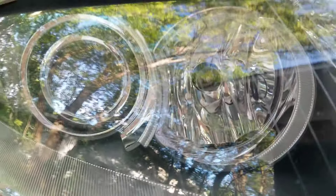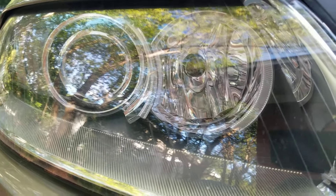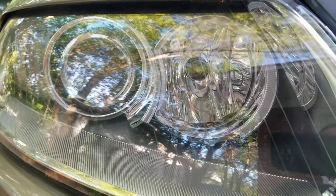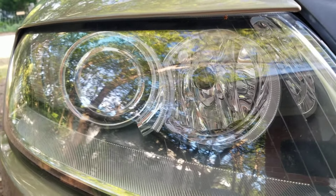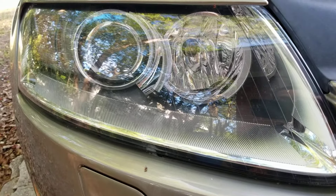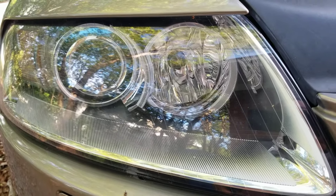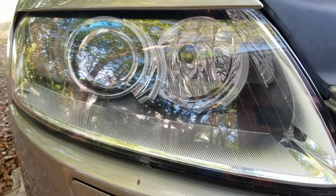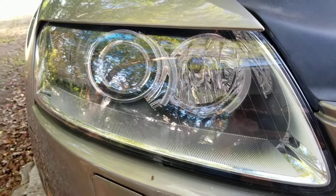I've got it all placed back in there — it wasn't too bad doing it blindly and one-handed. You just put it in and do the quarter turn in reverse and it snaps right in. Now I'm going to go in the car and see if it still indicates a blown bulb. If so, I'll have to get the bulb that came out — which would be an 1156, but the book says 7506.